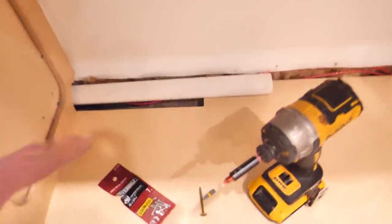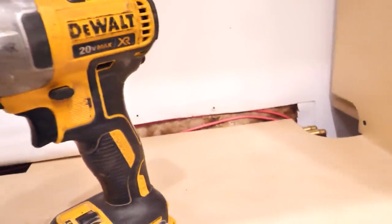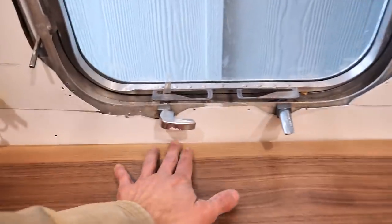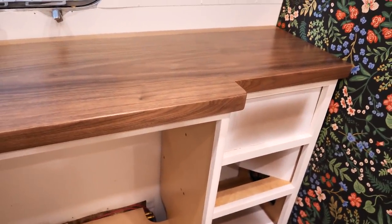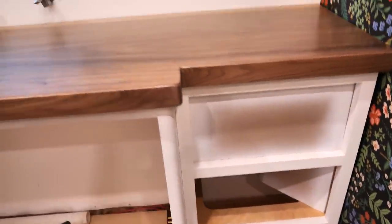We also had to cut here because the drain pipe was giving us issues. We couldn't get the cabinet leveled, so this allowed it to have a little bit more movement. So the next step is we're gonna plumb it out. The shower faucet's going here. We've got a water line that goes to a sink. The countertop here looks really nice. Pretty excited about how that's looking. I want it to fit pretty tight against the back, so I need a little work to get that dialed in and fit, and I need to cut a little bit off the back of it as well. But this is a big step. This is in, and it looks great. Unfortunately I didn't get it painted, but it is primed, and we'll have to come back and brush it all on from there.